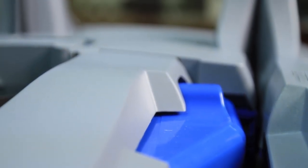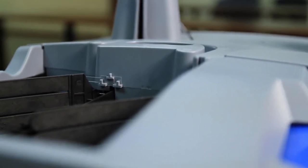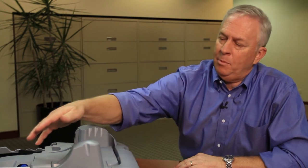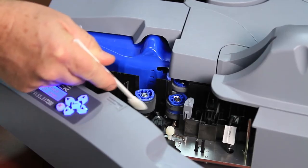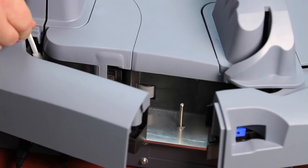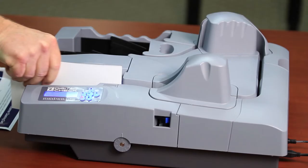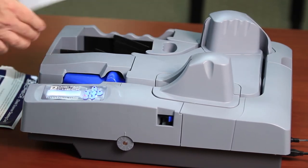The maintenance and cleaning of the scanner is going to be on a basic, periodic basis. When you're running at 15,000 to 20,000 items, it would be a time where you'd consider a cleaning cycle. At that point, you can put the scanner into a clean mode function. This is the function where you're launching the clean option that turns on the motors. From that point, you would use the swabs to scrub off the entry drive rollers, some of the path rollers, and the exit rollers. Then you would take a cleaning card and run it through the scanner about seven to eight times, flipping it each time.